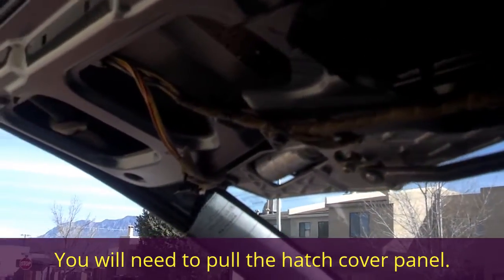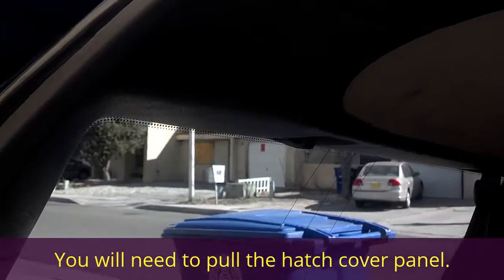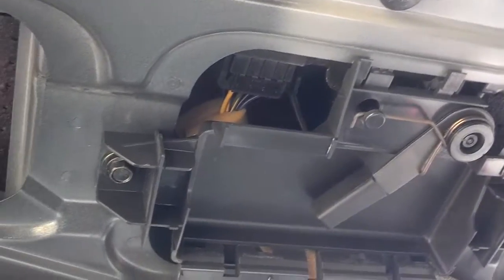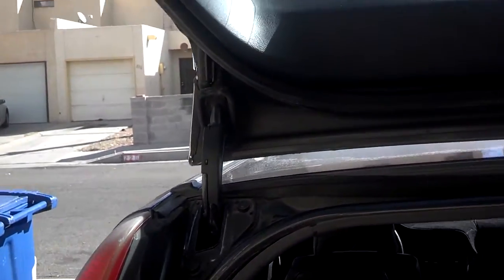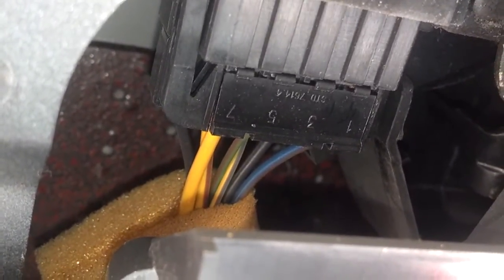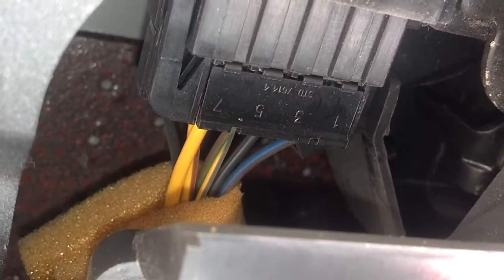As you can see, the wiring harness coming down through here — we're going to go ahead and pull this trim down and test the wires with an ohm meter. The harness running through there probably has about 15 wires, but we pulled the panel off because it needed the clips fixed. Looking at the latching mechanism, there are about seven wires that make up that latching mechanism, so those are the ones we're going to test for continuity — with the latch open and then again closed.